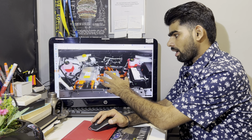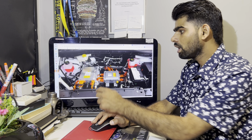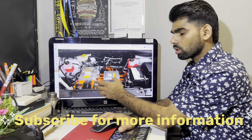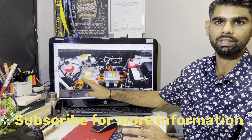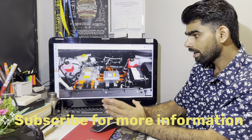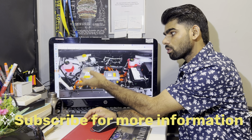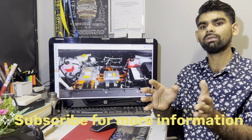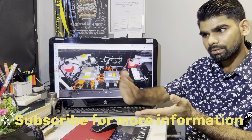This is a high voltage cable, but for the main component, you will have a yellow sticker with warning signs. So these are the two main identifiers. Thirdly, the orange cable and sticker serve the same purpose — but if the sticker falls off, you can still identify it as a high voltage component, because every high voltage component joint will be orange color, the same as the cable joint. Most people know this, but since this is a training session, we cover it from the beginning.